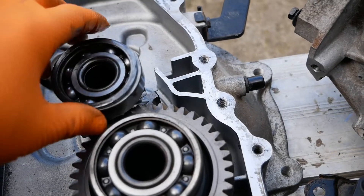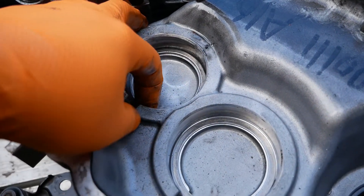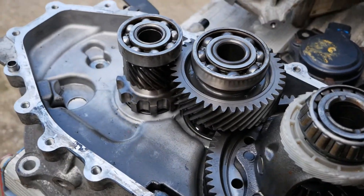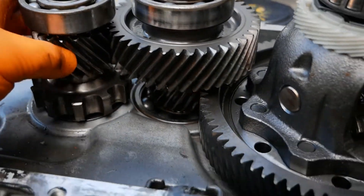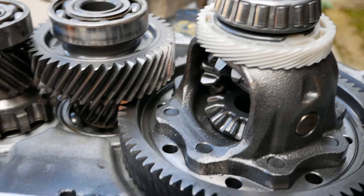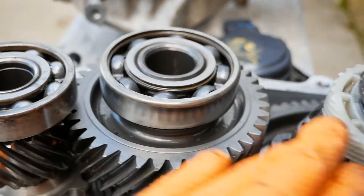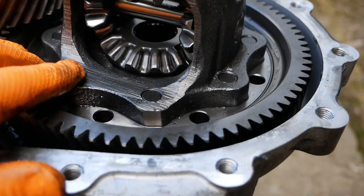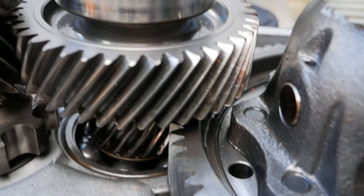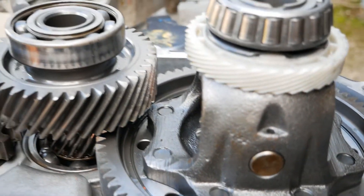You've got your bearings on the drive shafts and then a corresponding ring here which sits at the top of the bearings and is clamped when the casing is put together. Very, very simple gearboxes — theoretically, with very little work to do and no sliding gears, these things should last forever. As you can see, this one's bearings are all looking good after a hundred thousand miles, and the differential looks great inside — no noticeable wear at all on any of these cogs.